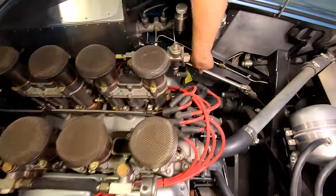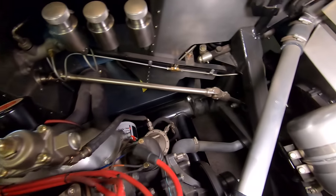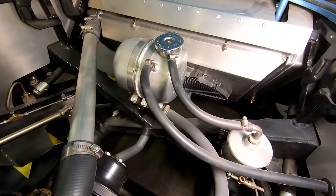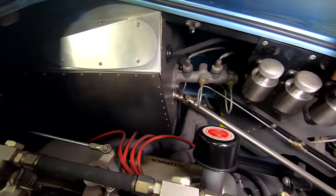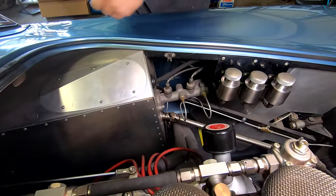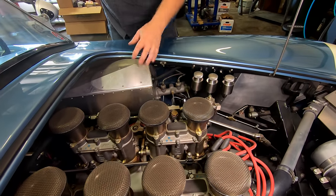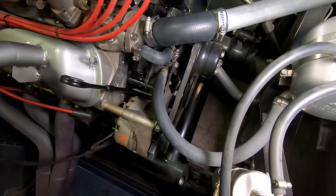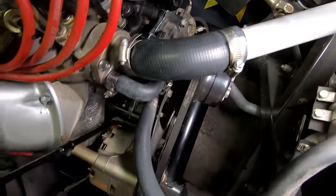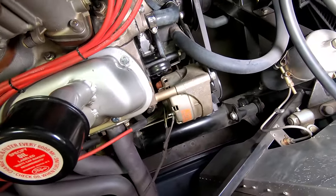The steering rod is a little different, and the radiator layout is a little different. Also, this X-member in the framework was not present on the Superformance. Here we have the brake master cylinder with its own individual reservoirs, and the clutch master cylinder inside has its own reservoir as well — this was completely different on the Superformance. One thing that's common on both is a very simple accessory setup: an alternator and a water pump, and that's it. No power steering, no air conditioning, no smog pumps.